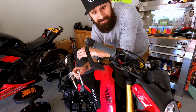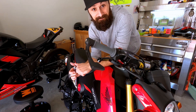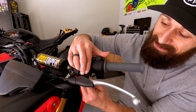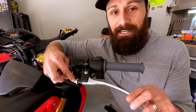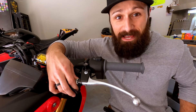The brake and brake guard are installed - I'm gonna move over to the clutch side and get this wrapped up. The clutch side, just like the brake side, is pretty easy. Instead of having a 10 millimeter bolt you've just got a flat head slot and then a 10 millimeter on the bottom. The tricky thing is you've got to pull the little sheathing back and then actually remove the clutch cable, but outside of that it's a pretty easy install. I'm gonna throw the time-lapse on and we'll get these swapped out.